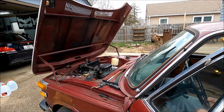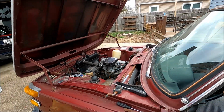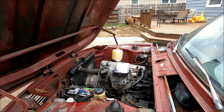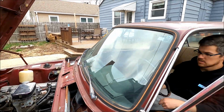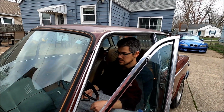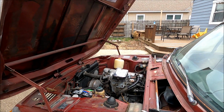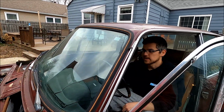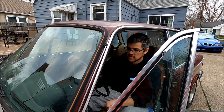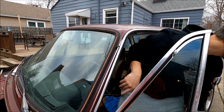It's idling. It's barely holding us. Temp gauge moving at all yet? It feels like it's so close to dying. I don't like it. It still had oil pressure, but I don't like it going so low. I don't want it to idle so low that it doesn't have oil pressure. The charge light keeps coming on.